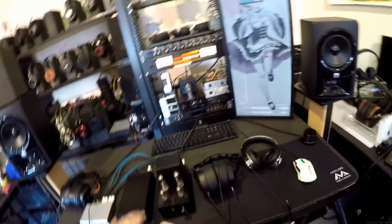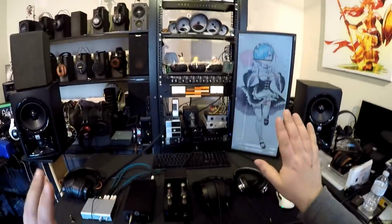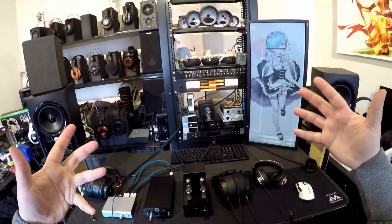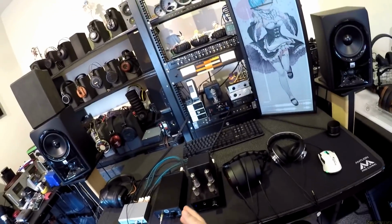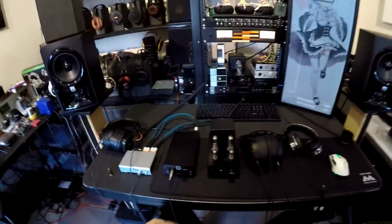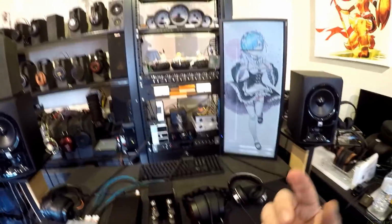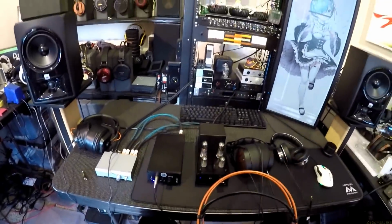Alright, basically, when you flip on that crossfeed, there's a middle all of a sudden where there isn't. There isn't a middle, and then mid-range all of a sudden is now behind you. It's not in front. I've done all the headphones on it, and it always seems to be a movement of mid-range from out to in. So they're obviously taking somewhere in like the 400 to, I'm gonna say 2000 hertz range, and that's the main blend tech that you're throwing in that. It seems a little warmer. Obviously, it's going to seem warmer if they're moving mid-range from just left and right to, not mono, but to a bigger plane. So I could see how that's helpful.